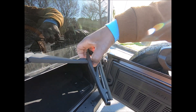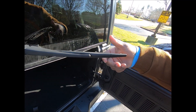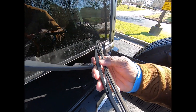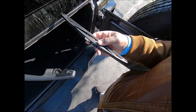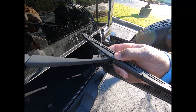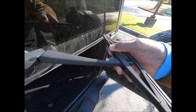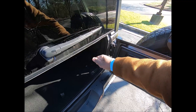It's one hand, it's really not a problem. That's on. So to take it off you're just gonna turn it like that — looks like it's broken but it's not. That little thing right there locks in. So to put the new one on you just slide it, get it to slide in that groove, and turn it around. That's how you put the wiper on and off.